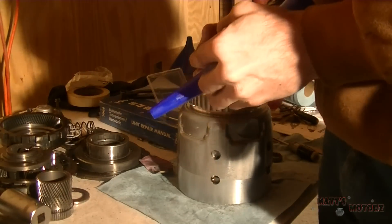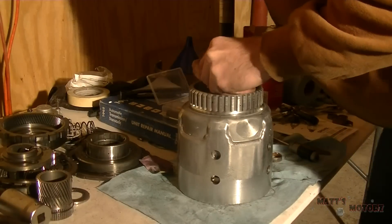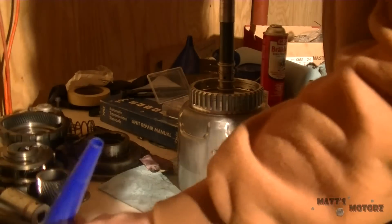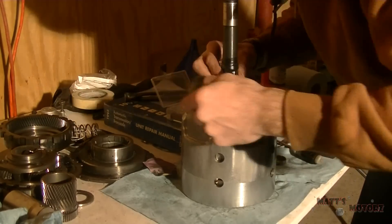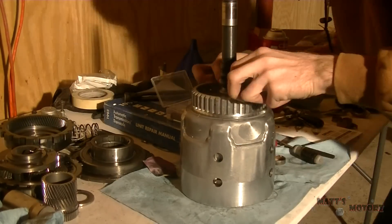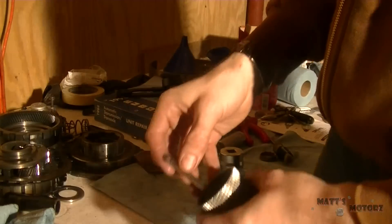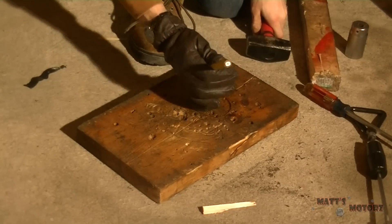You've got to get it just right. This beats buying the special tool for probably a couple hundred dollars - this is like a few dollars, just the price of the funnel. This is the last one - there we go, all four done. Now I'm going to tape it up real tight with electrical tape going all around the shaft. This should compress the sealing rings enough so they won't be damaged when the pump gets installed.